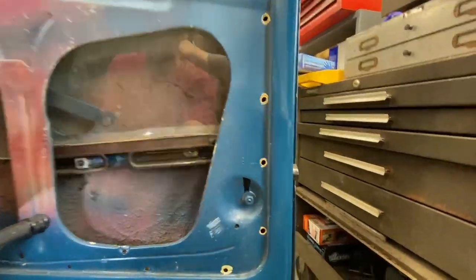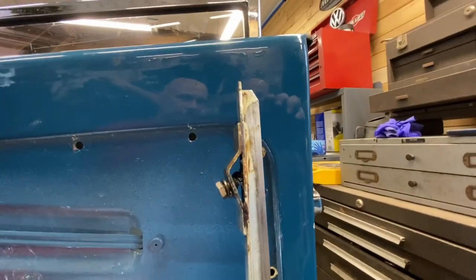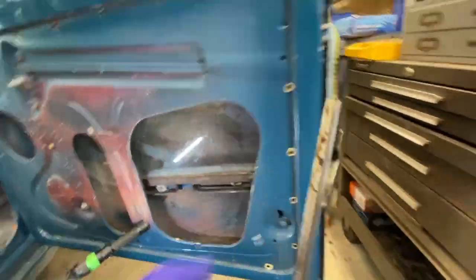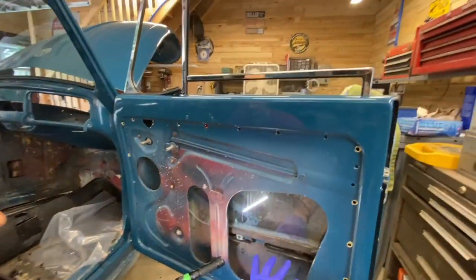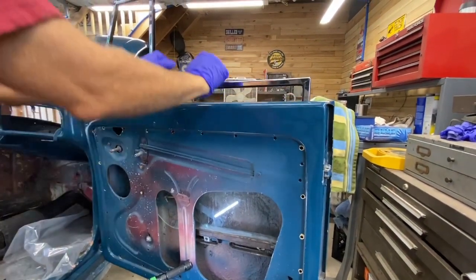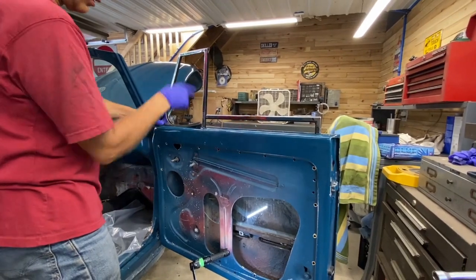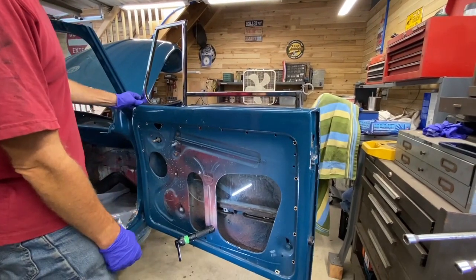In a similar way, it's the same kind of bolt over here, and right in here is another bolt — that's your other track; it's a right and left. This part comes through the door and provides the other side — that's the outside track — and then there's an inside track. You pull these guys off and have the inner window scraper off, then you can lift the window out of the door. That allows you to get into the vent window frame and track, and then that other track.